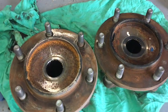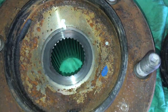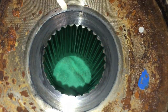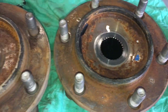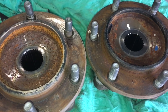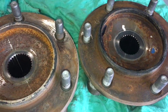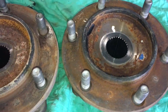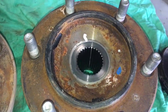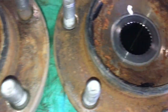Let's turn it over and have a look at the other side. Look at all the rust. You obviously don't want rust getting in here and causing problems. Luckily it didn't get past the nut and inside there was good. But there's a reason there's a dust cap - they seal really well, these watertight ones. As I said, I didn't have any in stock, so I've ordered some and I'm going to keep a spare set from now on. We're going to fit some old ones that are 95% good, and put some RTV to be sure - our only solution to get out of here ASAP. Just look at all the rust - compare the mess from it not being sealed properly.